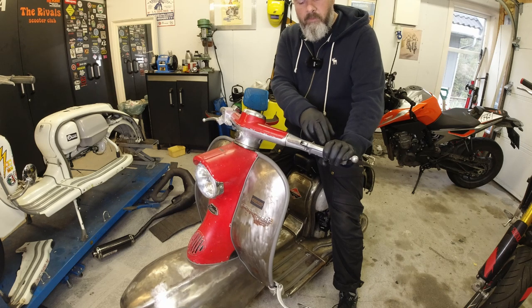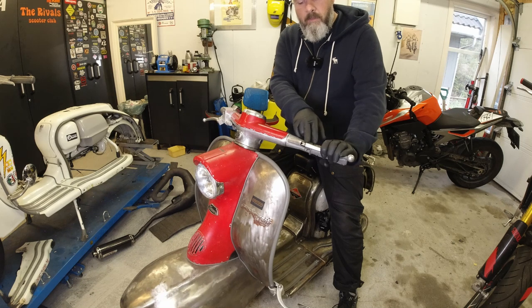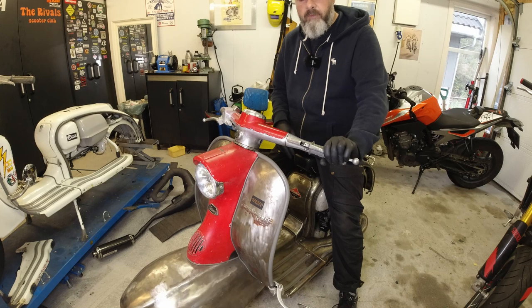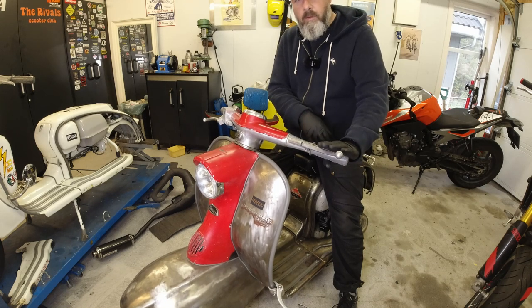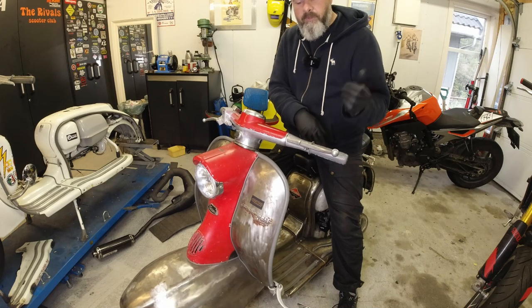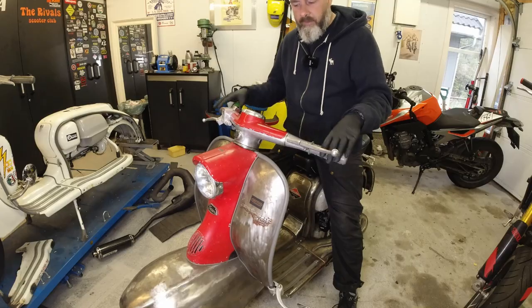So personally, I like it to engage about, say, 3/4 of the way in and fully loosen at the halfway point, and then I've got this little bit of free play both when the clutch handle is all the way in and all the way out. So I'm gonna take her outside and fire her up, and I'll see where she is.